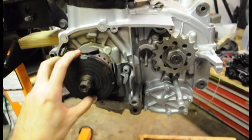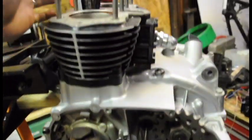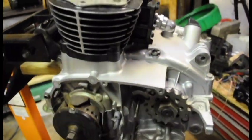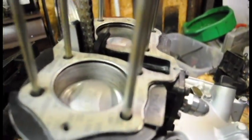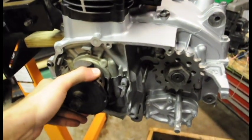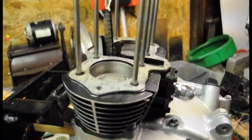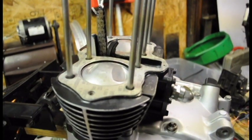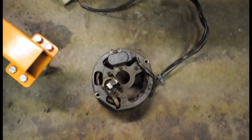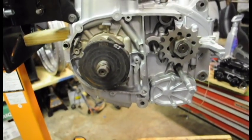I've got my stator on and now we want to make sure that our cylinders are at top dead center. You can see they're down low, not up high in the cylinders. I'm going to advance the stator — the pistons come up, that's top dead center right there. When I put the rotor on, you can see the timing mark will line up with the stator.